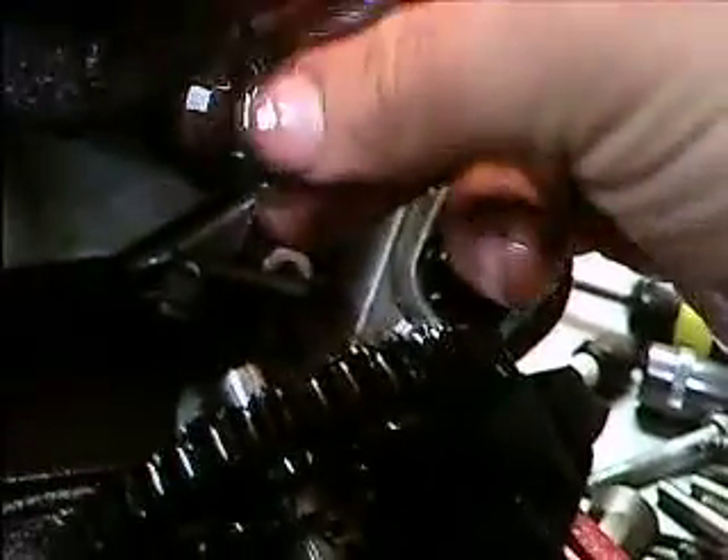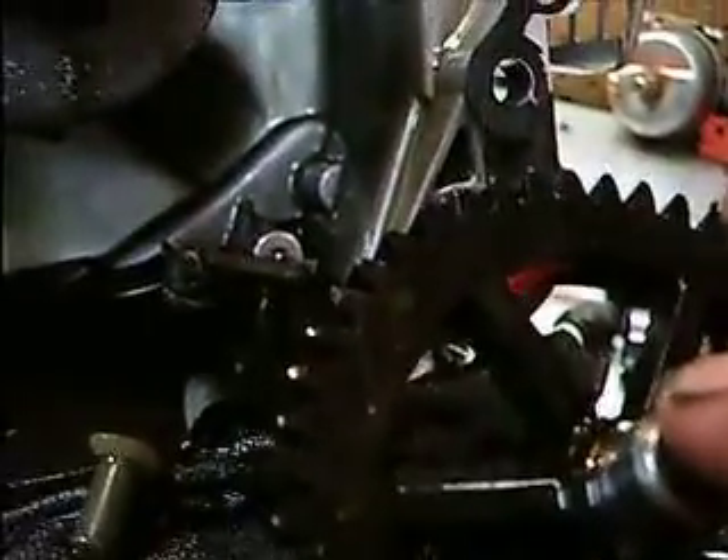Here's something right here — here's the spool, that little thing that pushes on the governor lever, like that. I have no idea what happened. Looking at the camshaft, there's a timing mark right there on the camshaft — you can see it in the light. The timing marks were completely out of sync. I have absolutely no idea how that happened.